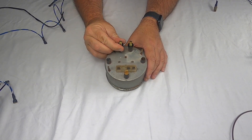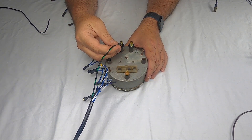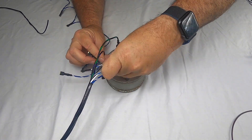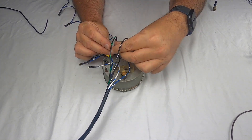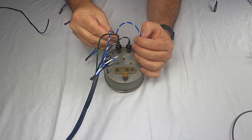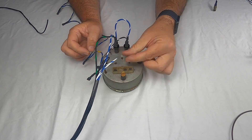Starting the wiring on the tachometer with the turn signals. The right turn signal gets a black-with-green wire on one spade — these are double-spade bulbs. The other spade gets a black-with-white for the left turn signal. Then the other spade on each gets a blue-with-white wire with a little U-shaped pigtail looping between them — that's for your hazard lights, so when you pull the hazard switch both turn signals blink in unison.